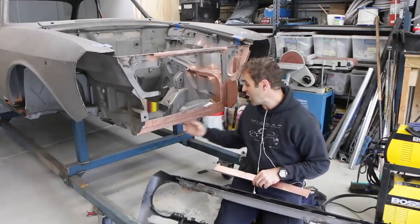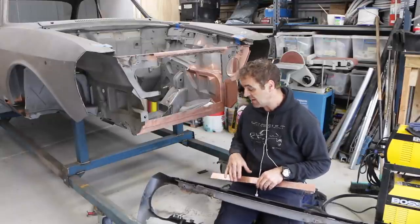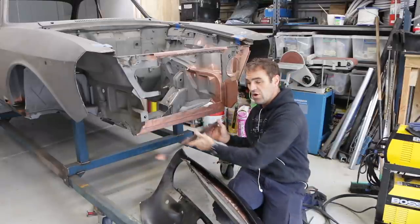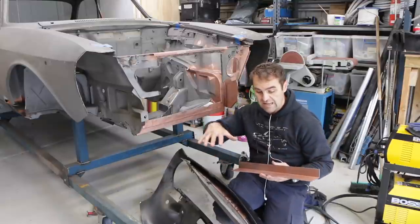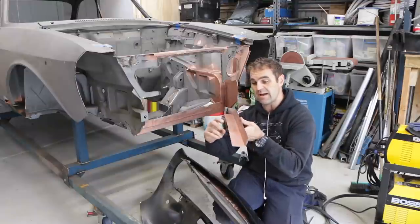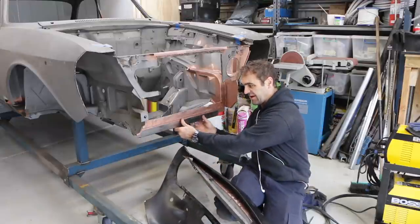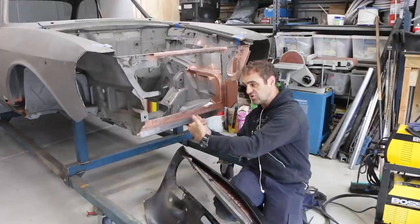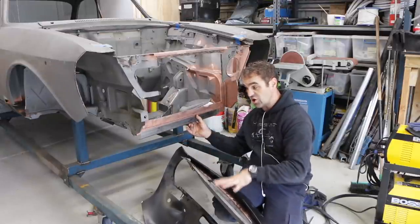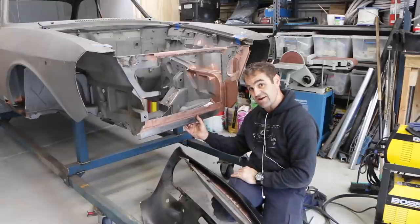This lower piece is now welded in and it's nice and solid, so I've got a good structure down the bottom of the car. I made up this panel here - it's going to go on like so. The way I'm going to line it all up is I'll get the nose cone back on the car, sit this in place, clamp it with some vice grips onto the lower lip of the nose cone, then tack weld this on, undo the clamps, take the nose cone off, and this can be welded up properly when I'm ready to fit the nose cone permanently. It'll be there in place ready to go, so I can move forward on other things like radiator mounts.